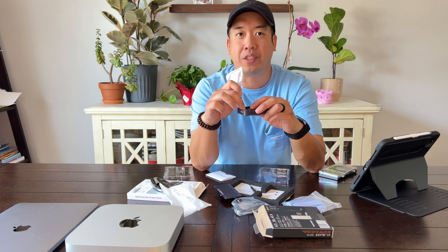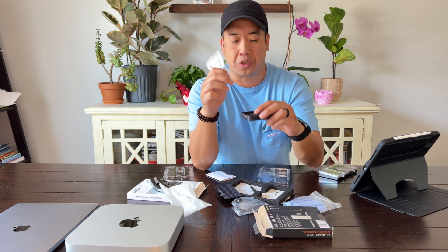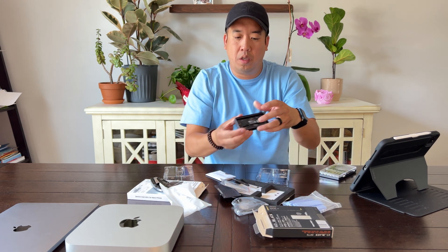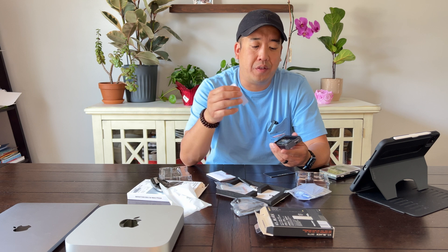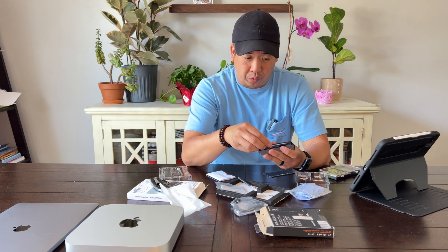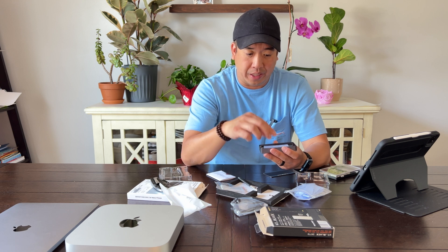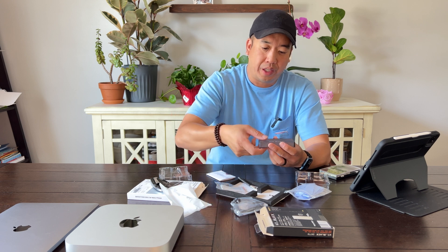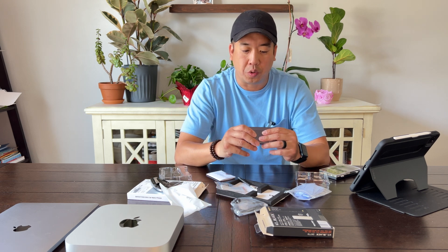As you get your SSD card, you're going to slide it in at an angle, push it down, and take one of the bolts to secure the SSD card directly into the enclosure. With the thermal pads — I have a nice thick one here that works really well. As I put it on top of the SSD card and place the cover on, you can feel there's a little give. This works out perfect instead of using two pads.